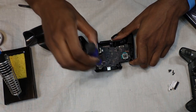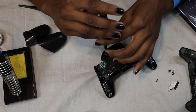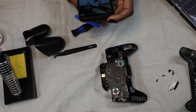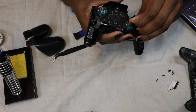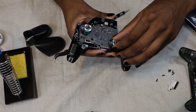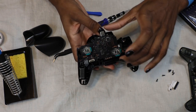I'm not a hundred percent sure if I needed to take the two screws out at the top — it seems like it only holds in the plastic piece for the sync button, but I ended up taking those out. Then I looked up a tutorial on how to remove the motherboard because I didn't want to accidentally break it, but it turns out I was being too gentle. You just slide the motherboard down out of the USB-C slot at the top and then pull it forward. I'm not going to remove the gray cable or the HD rumbles because they have adhesive I won't be able to replace right now.